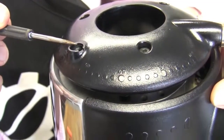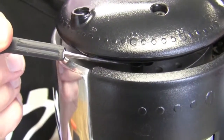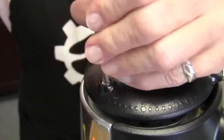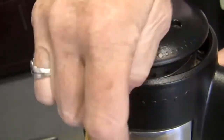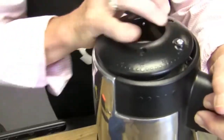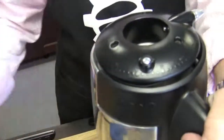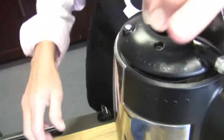This is the screw I took out initially — that's your stop. What it bumps against to stop is this little bolt down in here. Before you put the screw back in, take this all the way down — righty-tighty, lefty-loosey, just the opposite on this — until the burrs touch so you can't turn it anymore. Now the stop is over here and the screw is here. You want to take this back until the screw is on the other side of the stop.